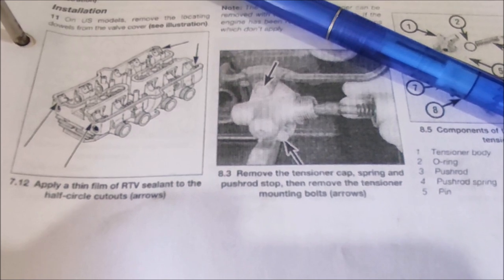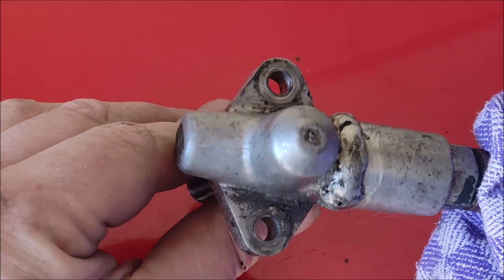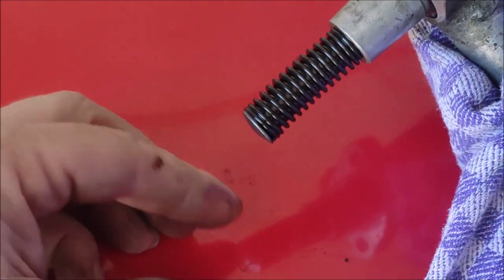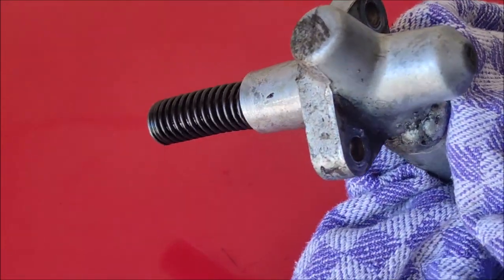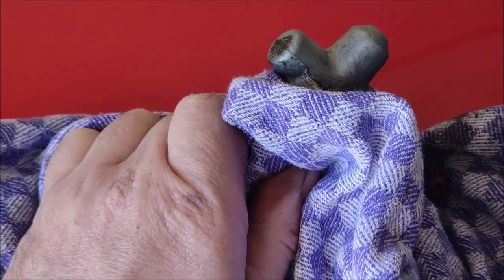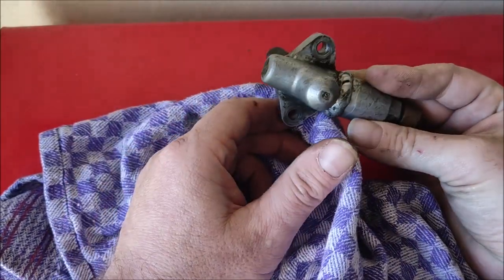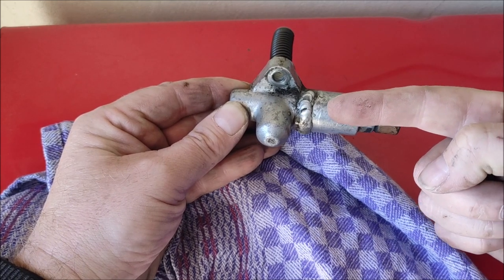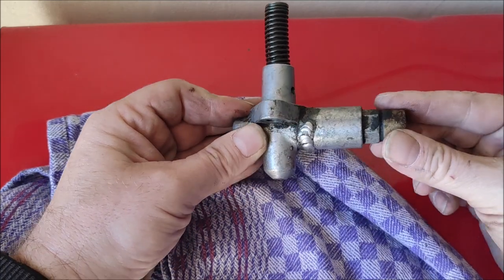So once you remove the cap there is a rod in here. I'm interested to see what's under this one. Looking at this closely, it's been welded — somebody has welded this thing, which is quite a feat because this is actually aluminium. I don't know why anyone would go to all that effort. Let me give it a bit of a clean. In the Haynes manual version, you take the cap off here where there is a push rod which goes around the corner and then pushes on this spring-loaded rod, which pushes against the chain tensioner.